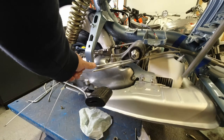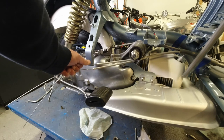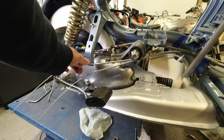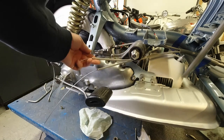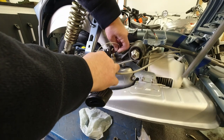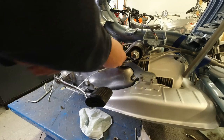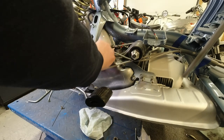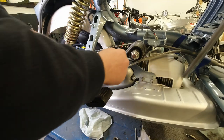So the front cable, if I pull the gear handle up, then I'll be pulling the front cable in. And that is this one. So front to back, back to front. What that means is this is the front one and it goes to the back. So obviously it's going to be easy to fit this one first. So just bend that out of the way, thread it in the adjuster. Like that. It's handy to have your adjusters about halfway house, because that gives you plenty of adjustment fore and aft, because you can actually get these a bit too tight anyway. So this is the one that goes to the back of the wheel, and we'll move it to the front.